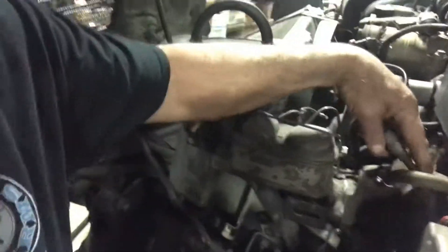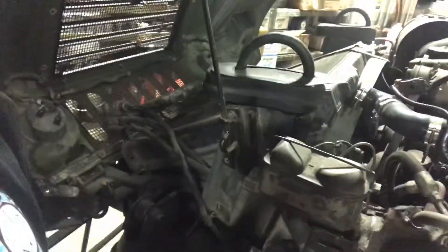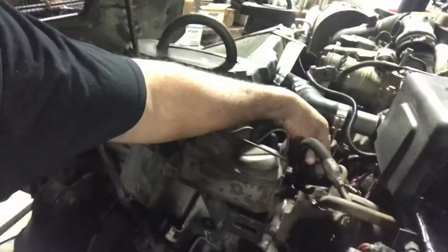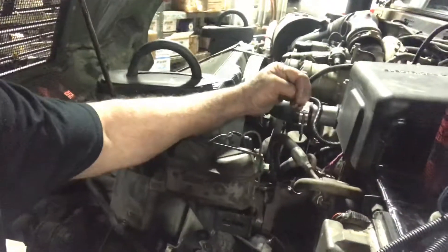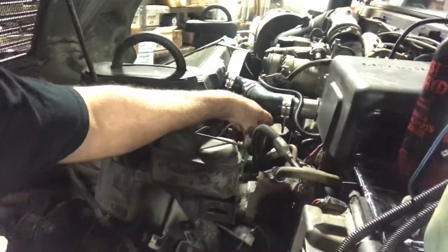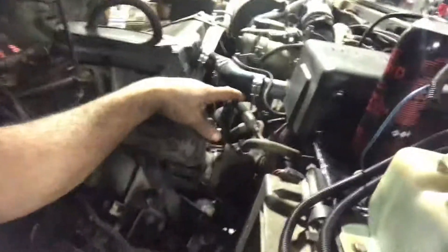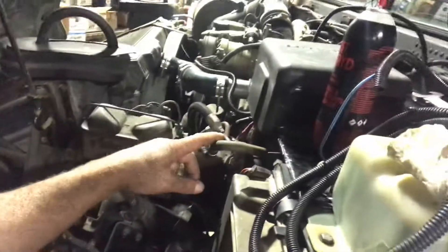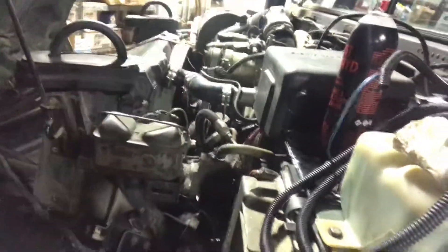Power steering was pretty slick. AM General uses these reusable hose ends — they actually screw apart. The first hose was long enough from the pump to the gearbox, bolts right in, no modifications needed. You use a factory hose right off the 6.5 and it'll screw right into the back of the Duramax pump, screws right back into the box. The second hose is short, but again it uses reusable ends. I went down to tubes and hoses, bought this hose for $10, screwed in the new hose, screwed in the fittings — power steering, $10.